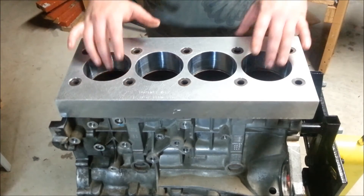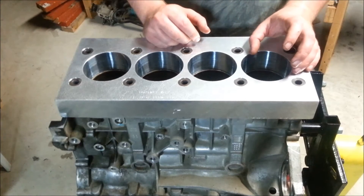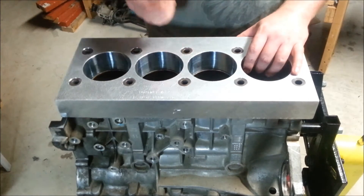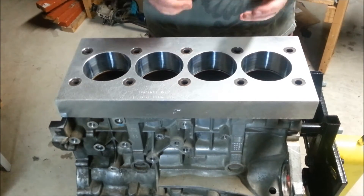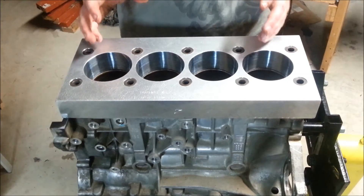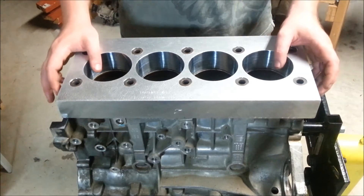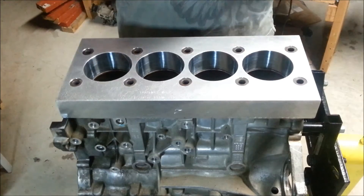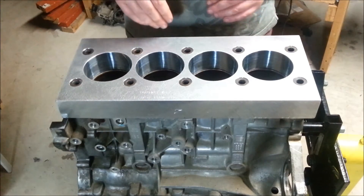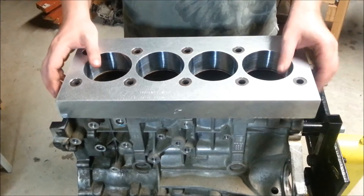This torque plate goes up to 87 millimeters bore diameter. The stock coupe is an 86 millimeter bore, and most companies offer an 86.5 or 0.5 millimeter overbore piston. Usually the reason you do that is because your sleeves have been damaged and need to be re-bored. A 0.5 overbore is very easy to compensate for in your tune, and in some cases you can get away without it — though note you are increasing your displacement. My sleeves are really good so they're only going to get re-honed; I don't have any damage to them whatsoever.